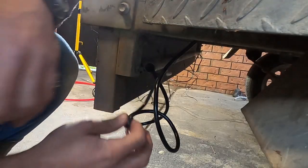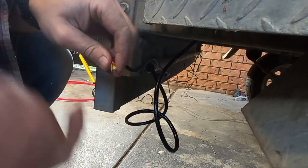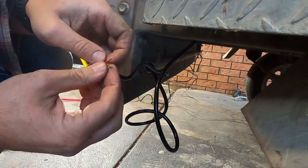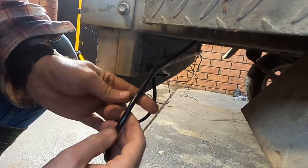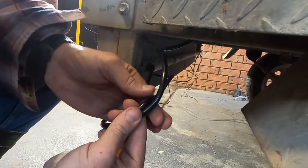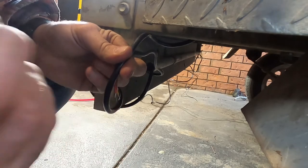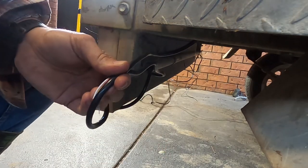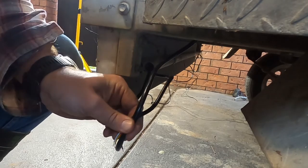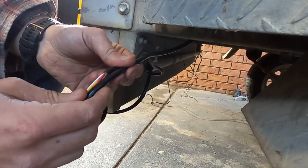Okay, for the wiring, my aim is to have these connections soldered and then shrink wrapped. But my aim is to have them protected, and I figure that if I get my lengths right and these joins in the right place, the slack that I pull back through this conduit, this join should then end up in the conduit, which will keep it that extra little bit safe. So just trying to judge how far that is. So we'll see how we go.